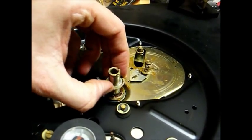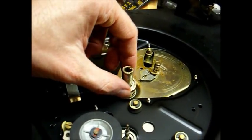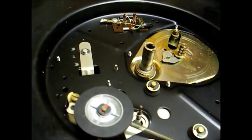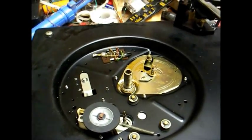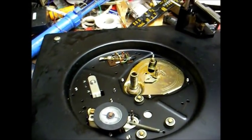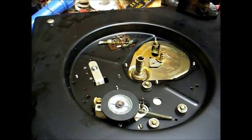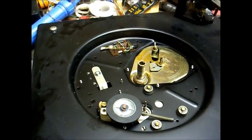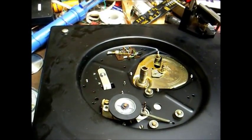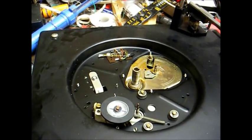You also want to pull these washers off the center and clean all the grease out of your bearing assembly and re-lubricate. You'll generally need to take the motor apart and clean it and re-lubricate — I'll demonstrate that in another video. My main purpose of this video is to demonstrate how to remove a seized platter, which seems to be an area that a lot of people have problems with, and they often ruin their record changer by getting in too big of a hurry or being too forceful. Just be careful with the heat not to melt anything and you should be good to go.